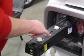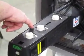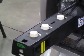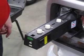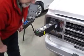Okay? Again, I'm looking here, and the diamond is on the side where it says U. So in this case, this side is about 7 to 7.5 inches up. And that is well beyond the 4-inch limit that you're allowed on these headlamps. Next, looking down through my window here, I'm going to check my horizontal adjustment. I've done my vertical, now I check my horizontal.